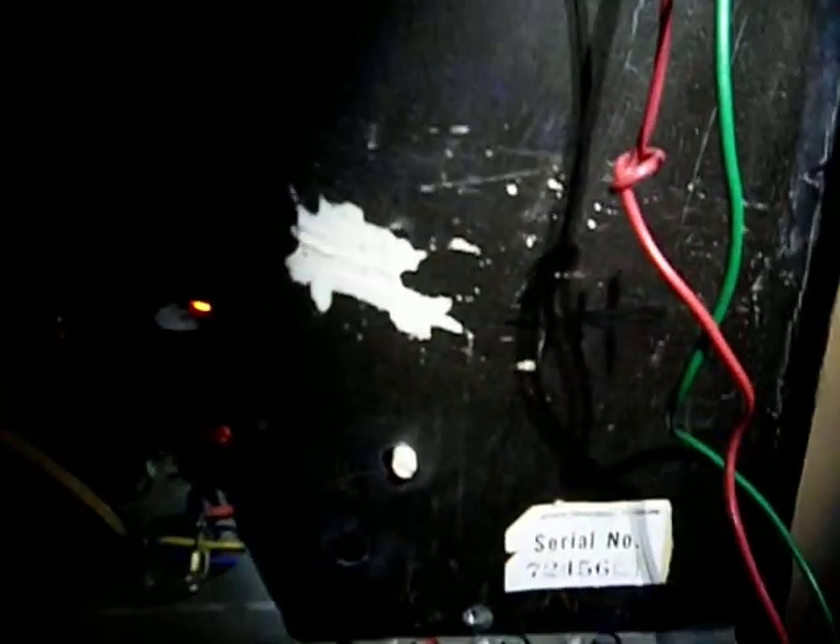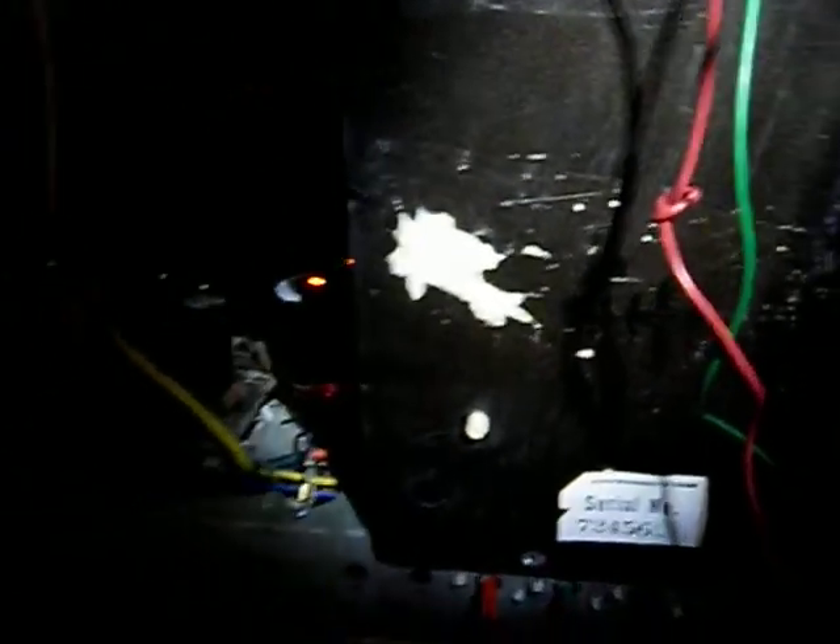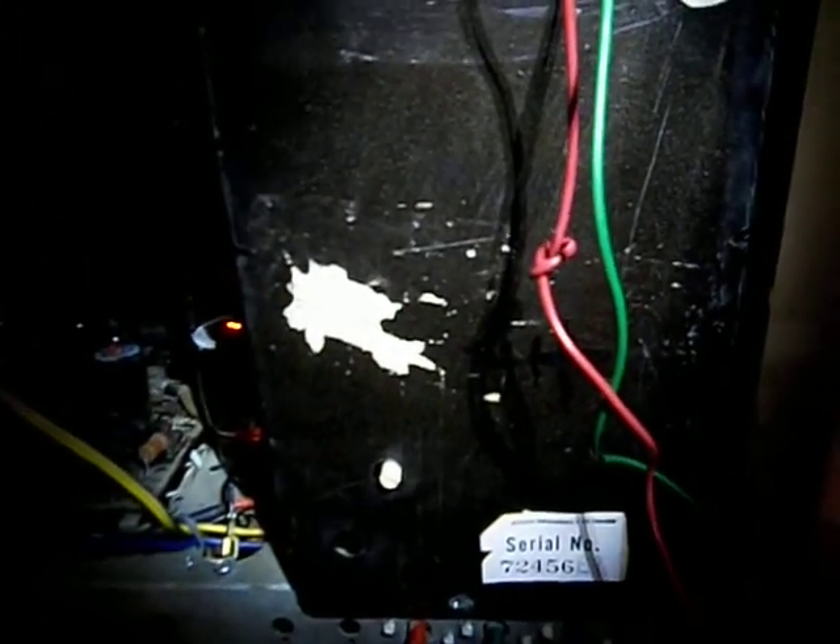Without this mod, if I just put the flyback cage on with the correct top, that flyback gets upwards of 180–190 degrees, wax starts dripping out, the whole thing gets kind of soft. In this day and age you really can't afford to be smoking flybacks because they're just hard to come by, so a little ounce of prevention is definitely worth the pound of cure. I've already tested by aiming the muffin fan right on the flyback with the cover off and it doesn't exceed 100 degrees, so if I can get that kind of performance I'll be very happy.